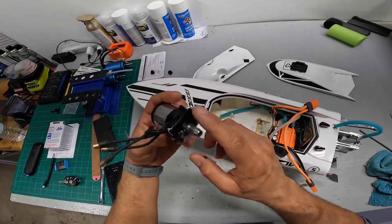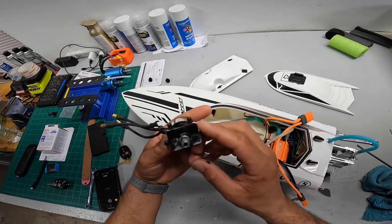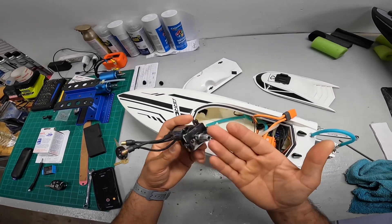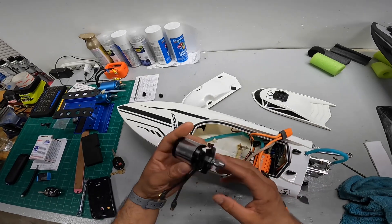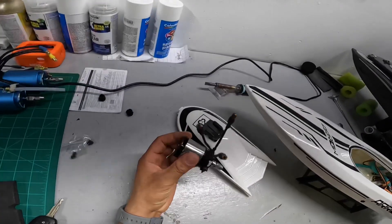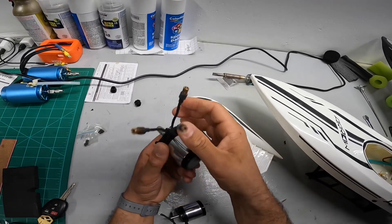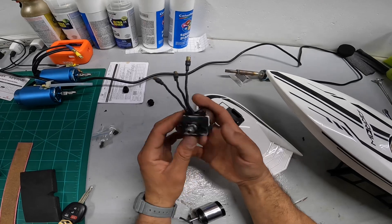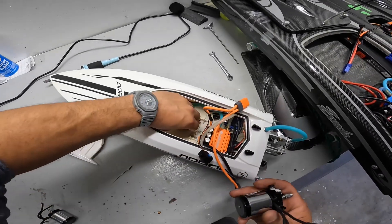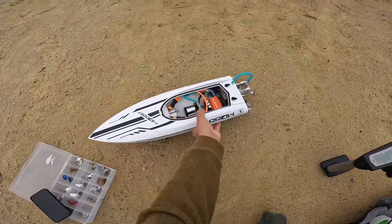This was supposed to work - I'm still using the stock motor mount, just modified it with some bushings. It still holds the water and flows the water fine, doesn't leak anything. There are so many other options for motor mounts on these things. So here's the swap - our old motor. We soldered on the connectors, using the same connectors. I'm out of six millimeter bullets but these should work fine. We'll drop it back in and hopefully tomorrow we'll do another 8S pass.